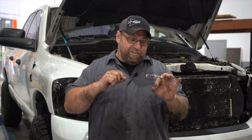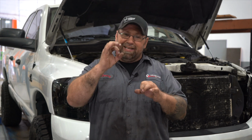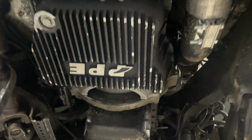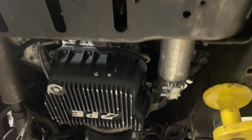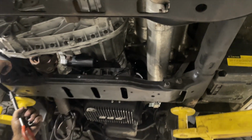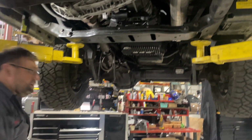There is one tool on this that if you're a Dodge guy or a shop guy or just an everyday guy, it's a $30 tool. It goes into the port, this little hole right next to where you get the torque converter bolts out, that rotates the flywheel. It's probably the best tool I've ever used on a Dodge. It works on any second gen, third gen, and fourth gen Dodges. It's just a wonderful tool. That would be the tool that I would say is a must if you're going to be pulling a transmission, even if you use it once or 3 times.